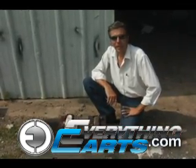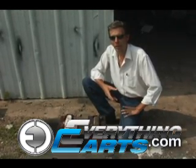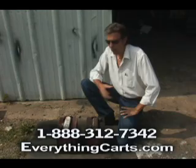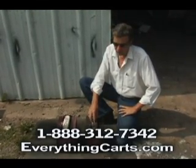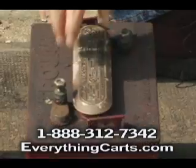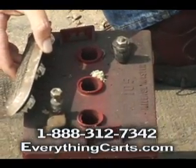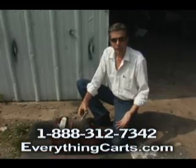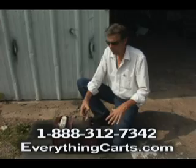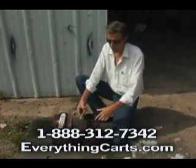One of the questions I get asked most often is: do I have a 36 volt or a 48 volt, and how do I determine that? It's fairly simple. Look at your batteries — you should be checking the water level on your batteries once a month anyway. Pull the top off, and if you only have three fill holes, this means it's a six volt battery. Six batteries times six volts is 36. So if you have three holes, it is a six volt battery.